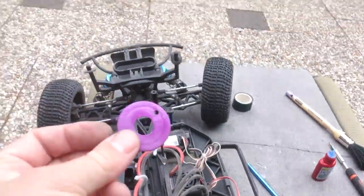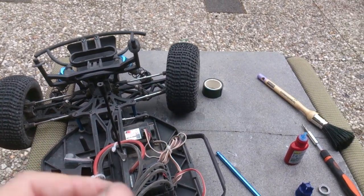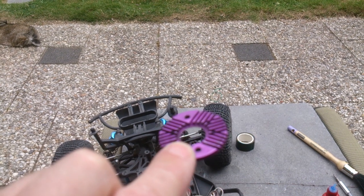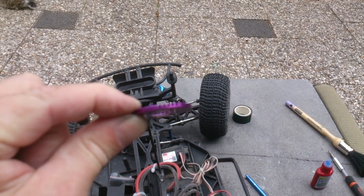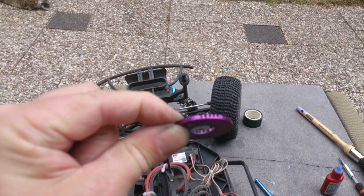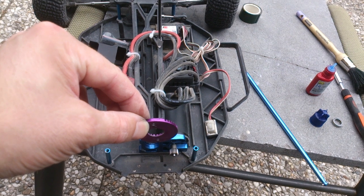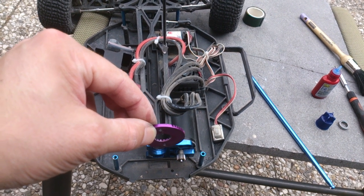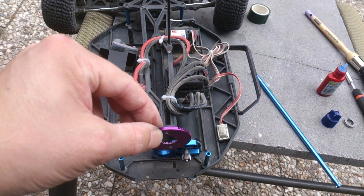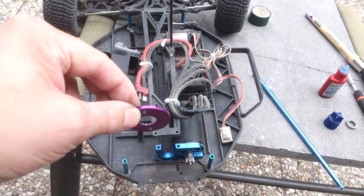I have a solution for that. Back in the old days — about 20 years ago — we had brushed motors that got hot, so they made accessories in the form of aluminum cooling plates. I'm hoping this smallish cooling plate will give me 2 extra millimeters to move the driveshaft in, which should hopefully give clearance for the rock guard. The rock guard doesn't keep sand out, but it should be enough to keep rocks from getting wedged between the motor mount and the slipper clutch.